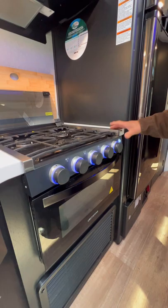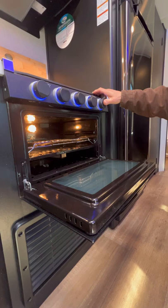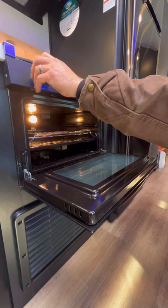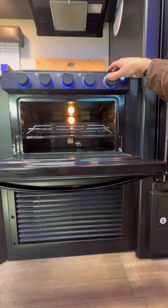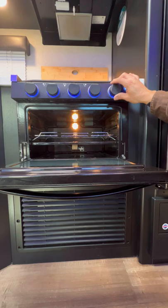For your oven, you may have to prime this thing probably 10 or 15 times. You hold that in. You have a pilot light right over here and you can see it in the back — that's going to be your pilot light. Hold that in for about 10 to 15 seconds. You let go, and there you have the oven now.